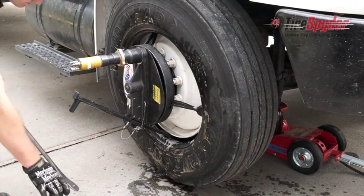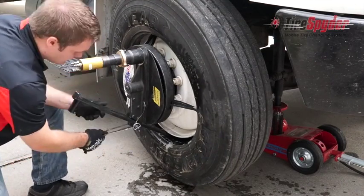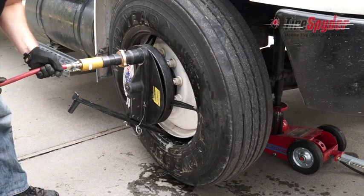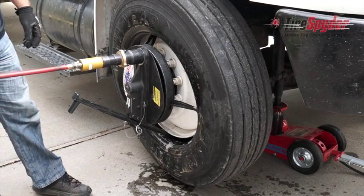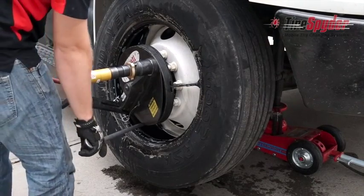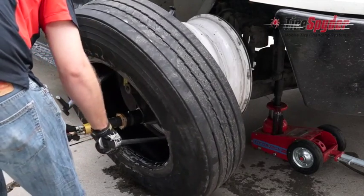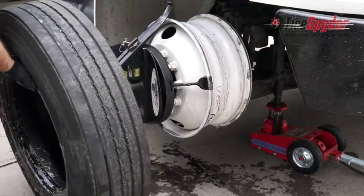If the tire spyder binds up too much, reverse the rotation back to 12 o'clock and ensure that the bead opposite of the spyder iron is in the drop center. Reach in and grab the second bead with the spyder iron. Then rotate to the 8 o'clock position. Insert the tire iron to the right of the spider iron and continue rotation until the second bead is clear and the spider iron is at the 12 o'clock position. Then remove the tire.